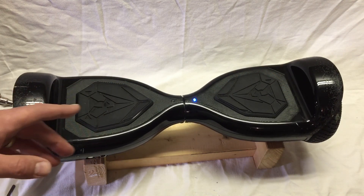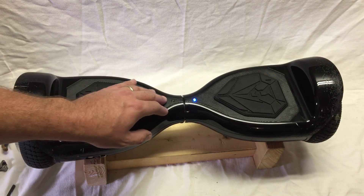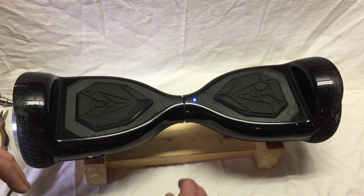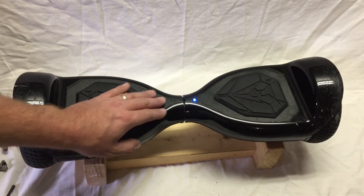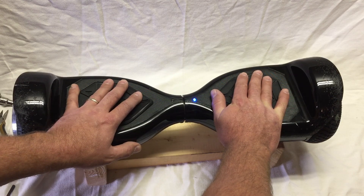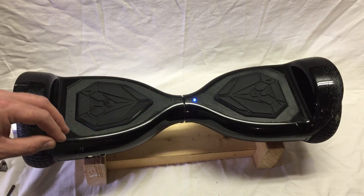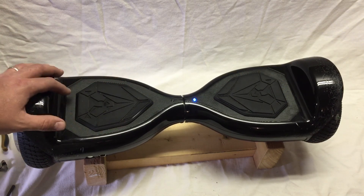What initially happened is my son took it off a step about four inches tall, and then we had the perpetual blinking light. After doing some research, the red blinking light sequence was different from every resource I found, so I just went to my old troubleshooting techniques. I originally recalibrated it to get the blinking light to go away, then messed with it and got it to where one side worked — but as soon as I activated the other side, the red light started blinking again and that side was dead. That's how I determined the issue was on that side and the balance sensor was most likely the culprit. I happened to have another hoverboard with an identical part and was able to switch it out.